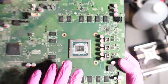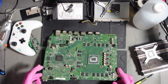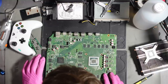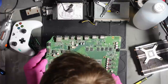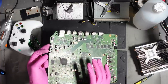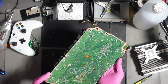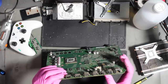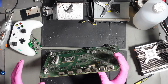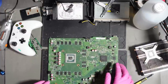Overall though, the top of the board — the APU side — looks fine. I'm not seeing any signs of corrosion on this side of the board. But on the other side there are a few areas which need sorting. I think it's just a clean-up to be honest. The HDMI port looks mint, USB ports look okay — all of the ports look fine. I think this is just going to be a case of clean-up.